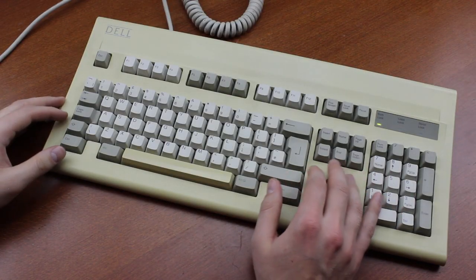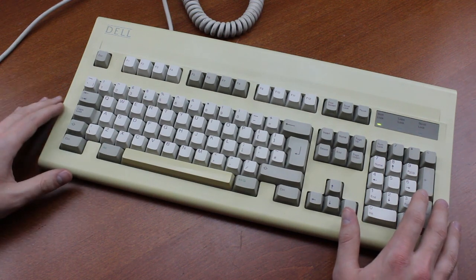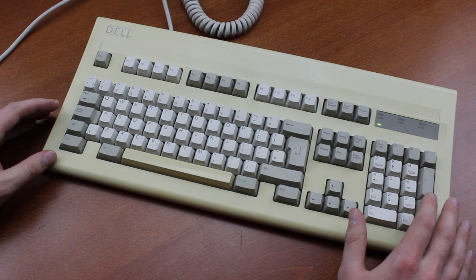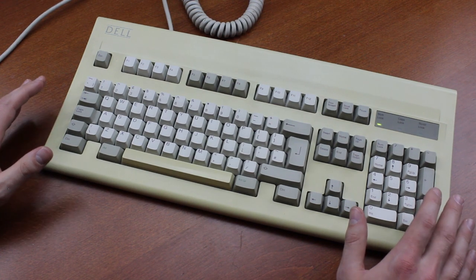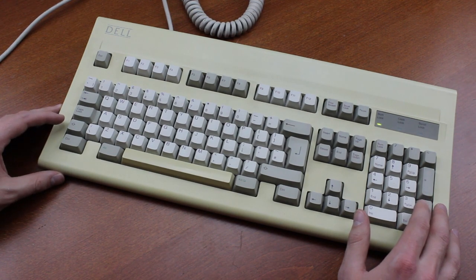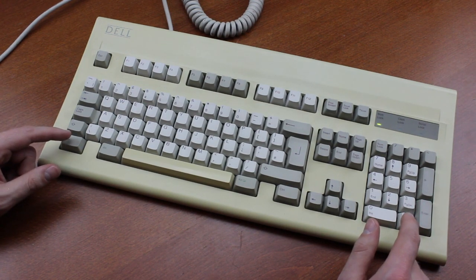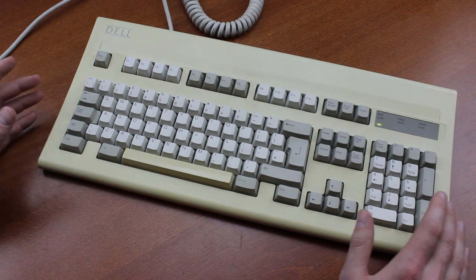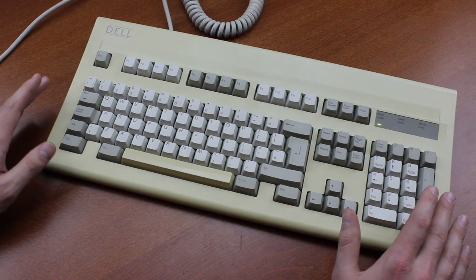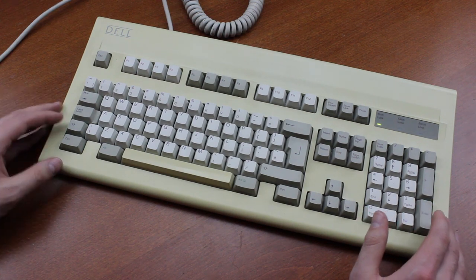Between great build quality, nice keycaps, very nice switches, a modern win-keyless layout, and an easy-to-adapt PS/2 interface, this is a great keyboard to use. Considered the most desirable model in the entire Dell AT101 range, I'd say their reputation is well-deserved, although the prices you see on eBay are pretty criminally insane. Note that it does have two-key rollover, and a matrix that's not the most efficient I've ever seen, so in some games you may have some key combinations block, but it's not terrible or anything. For the vast majority of gaming applications, two-key rollover is fine, and I had no issues of significance during testing.